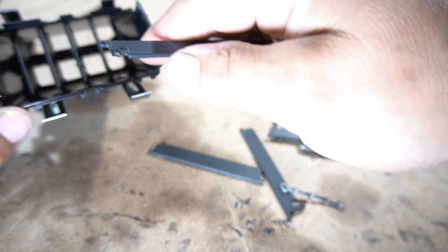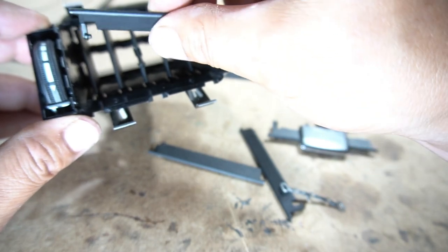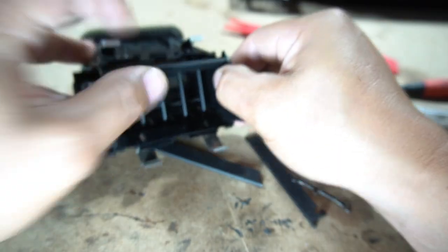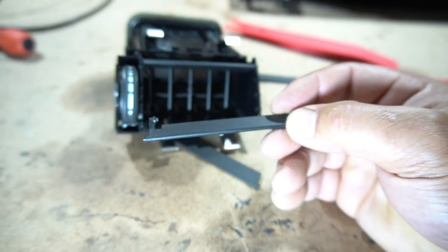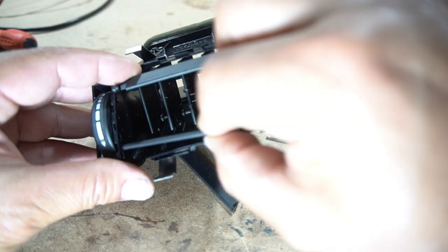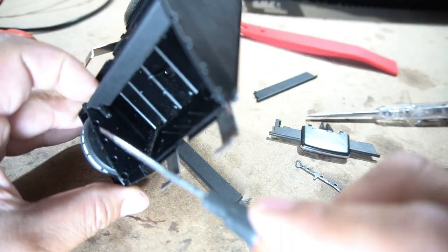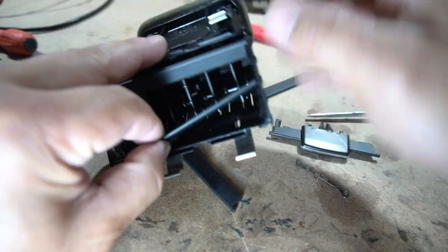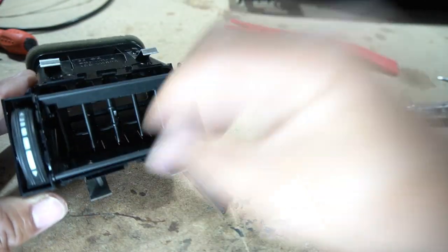Now let's reassemble this. This is probably the easiest way to do it — it is a little bit tedious, but it's probably the best way. Start off with the top and the bottom louvers, just put these back in. There's the top one back in. Put it in the same way it came out — you have the bottom piece that curves up and the top piece that curves down. Put them in the holes; it has a slot for each louver. Put it in there and push it in on the other side as well. Bottom one with the bottom, and that's in.